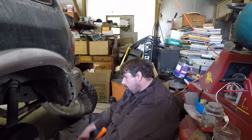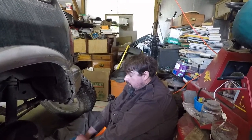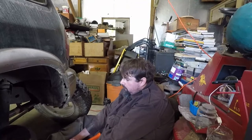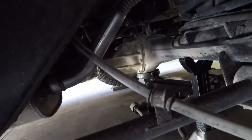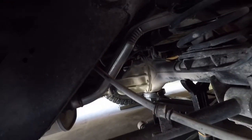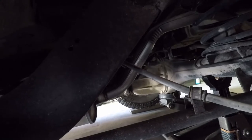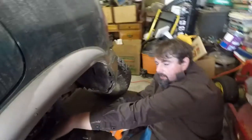It's only a 21-year-old vehicle — how much of a possibility is it that the rear end could be causing this? Well, the rear end was full of metal shavings when I had the fluid changed, which would pretty well explain why that wheel is getting favored. This one could be stripped, but it's actually moving the drive shaft easily, so this is connected fine and I'm not feeling a whole lot of play.